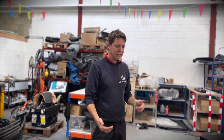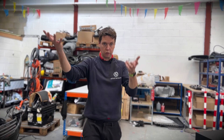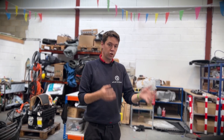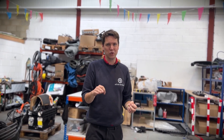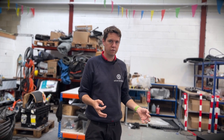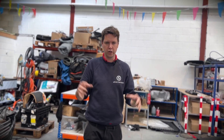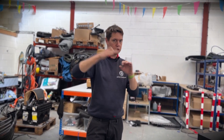The battery box itself raises up inside these rails. You install the frame system first with the motor, which rolls under the vehicle and bolts on, creating a second chassis onto which the battery pack attaches for rigidity and strength. It does add some weight — this biggest battery pack adds maybe 100 to 150 kilos, equivalent to having two passengers on your back seat. A split screen, for example, was originally around 1.2 tons and goes up to about 1.5 with the entire electric conversion, which still gives you 500 kilos of carrying weight. The later bay window campers have even higher payloads, giving you even more space for carrying.